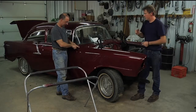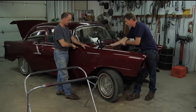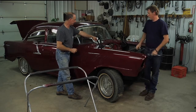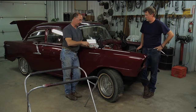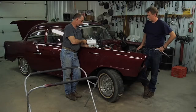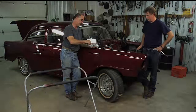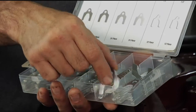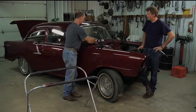What we're looking at now is how the top of the fender comes across the top of the door, and these actually, just as they sit here, are really good. If they're not, we can add shims to the equation. These shims are U-shaped, so the bolt can be in place while you raise the fender just a little bit and slide the shim between the fender bracket and the top of the body. The shims come in different thicknesses, so we can adjust accordingly to get the body to lay exactly where we want it.